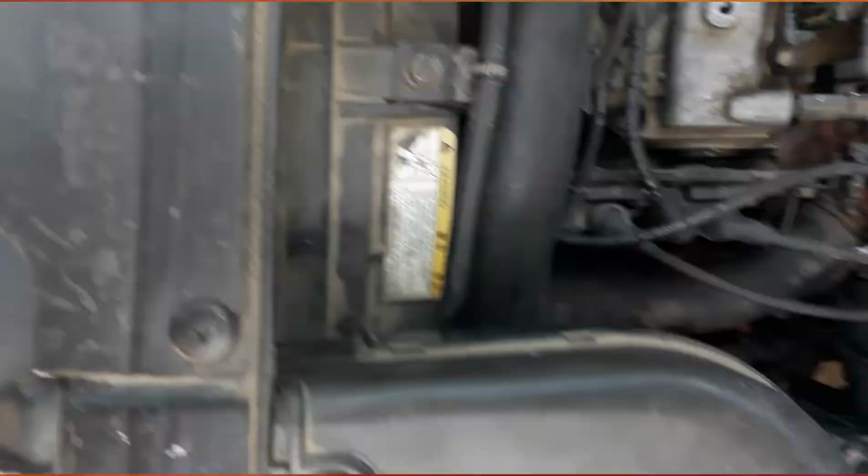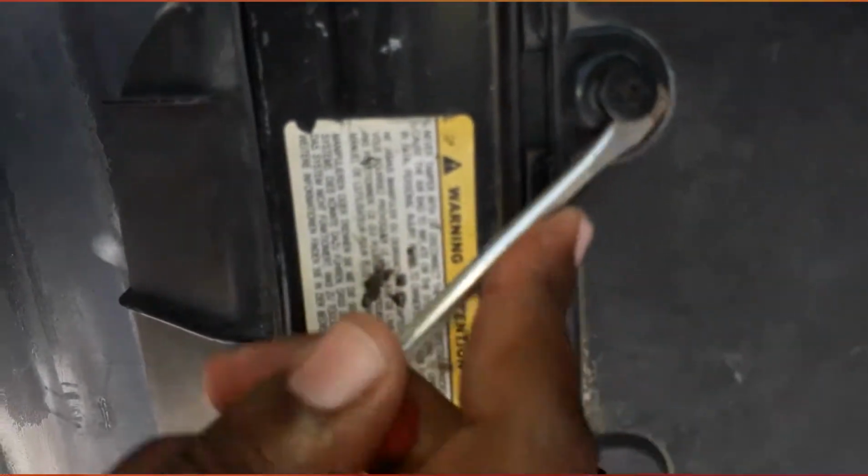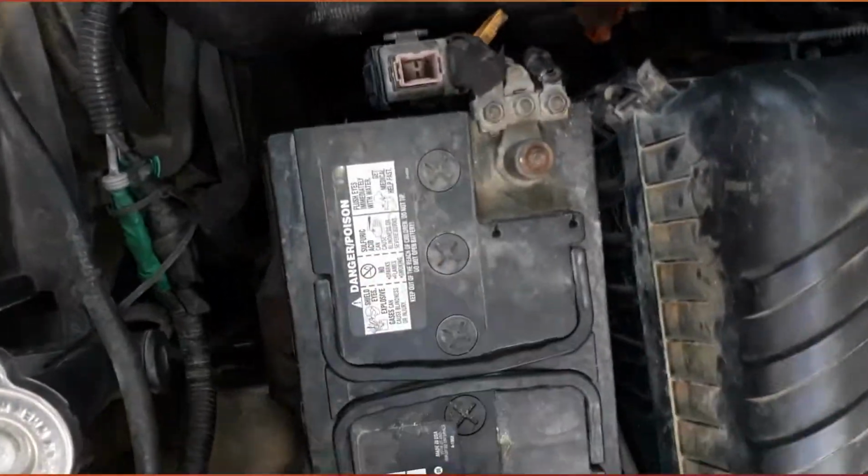Show you guys. Take off the battery. Well, it's a little different because you have to do this intake first. It's best to use a star screwdriver or something. Just roll it up, take another flat, and put it under to get it up. This will be difficult sometimes, you gotta rock it. Best thing, take off the positive and the ground. Some people say ground first. But yeah, you take out a ground, but I gotta take out a positive. And it's ready. This is saying that they don't have no current towards it.